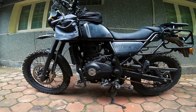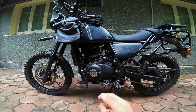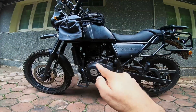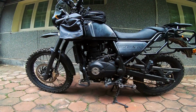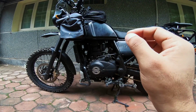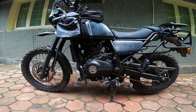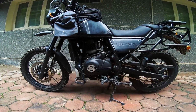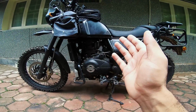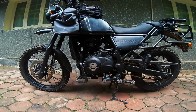Well, I did not do anything to the valves, guys. I just reconfirmed my inlet settings. I loosened everything. I put back the metal blade in the right gap where you're supposed to put it. I don't really know what I should be calling that. And I just redid the adjusting nut. That's about it. Nothing more to it. My valves hadn't moved one tiny bit since the last time, so all's well.